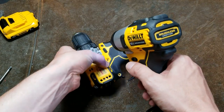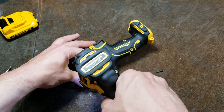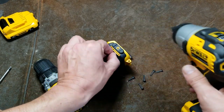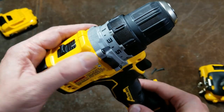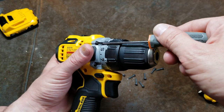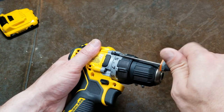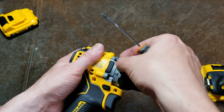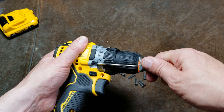This is kind of an interesting design where we have eight screws, and then they have the cross-screwed gearbox, which does make it a bit more stout — so we have a total of 12 screws. There is some pretty stout nylon they're using in this, and even these little screws are held in pretty tightly. They really made those holes a little bit smaller just to prevent these screws from coming out. The gearbox screws are the same length as everything else on the tool, which is nice.